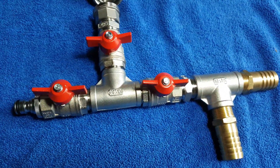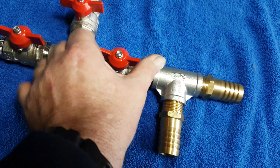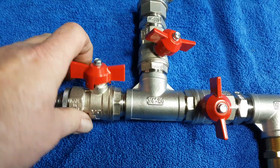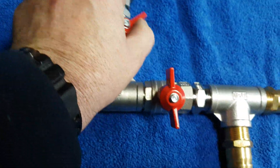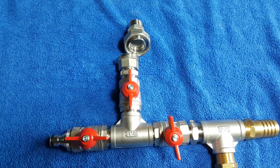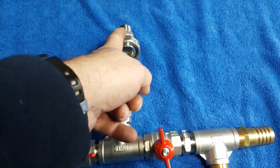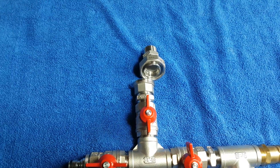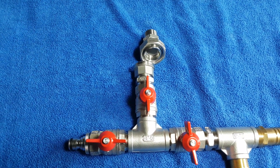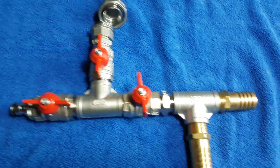You've also got the option to just fill your tank up. At that stage you turn your tap off at this point — so that's closed off — then open this and you're able to fill up. If you're doing it that way, you'd put an overflow in the tank, so as the water comes in and goes into the tank it doesn't spill over into your van. You'd put a good one-inch pipe coming out as an overflow system.